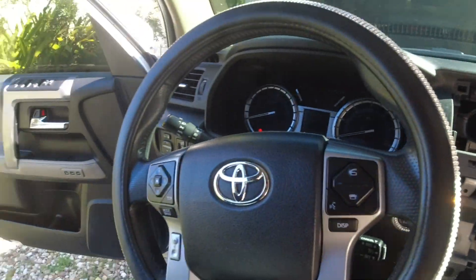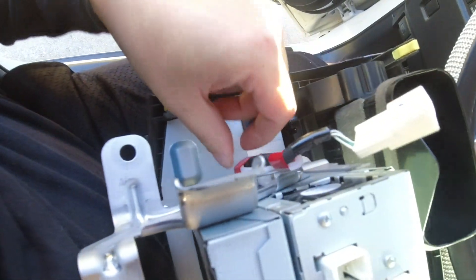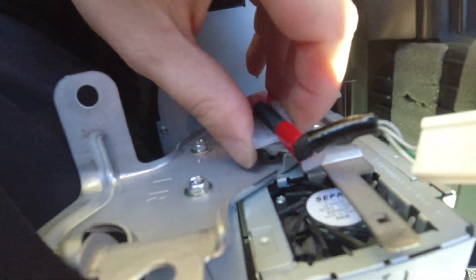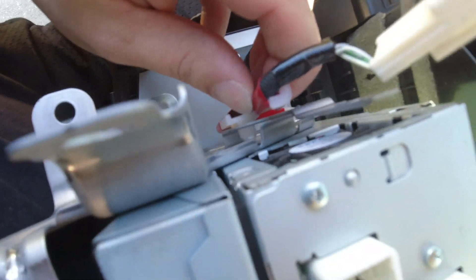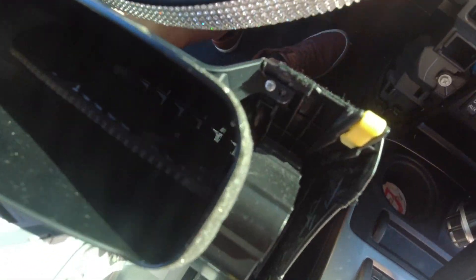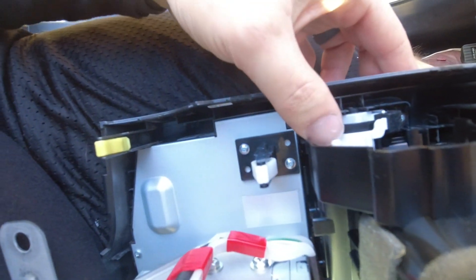This hazard harness is going to have to come off the old radio so we can plug it into the new one. The stock radio had it clipped on the side very cleanly, but with this we won't be able to use the side bracket — it'll just be a wire in the back. There's a clip that we'll squeeze and pull out. As for the air vents, I think they just clip out, or there might be some little screws.